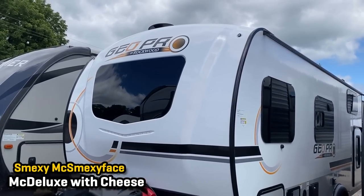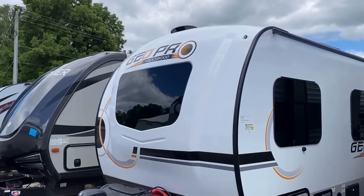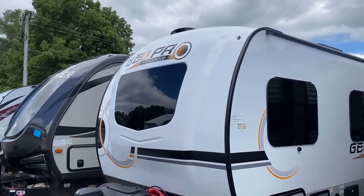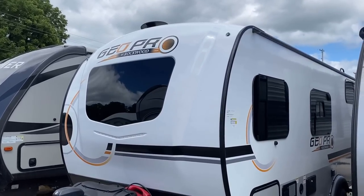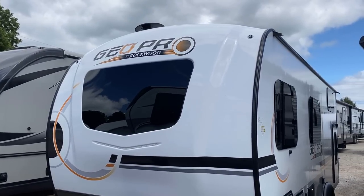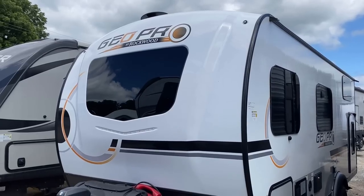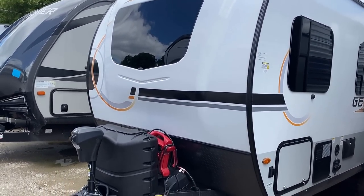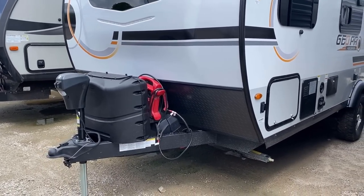These things have that spaceship look on the front end. Notice how that nose cap actually wraps over the roofline — it overlaps with the roof, which moves one of the most critical seams, the front termination strip where the roof meets the front wall, from an area of high stress to low stress. I'm not saying it's guaranteed foolproof, but they've done more to prevent leaks there. Behind that nose cap there's actually a one-inch laminated wall, which most nose cap brands don't do, and they run a radiant barrier layering down that nose — the same stuff they do on the big Rockwoods.